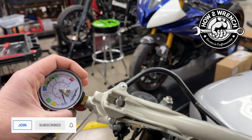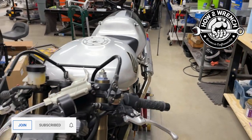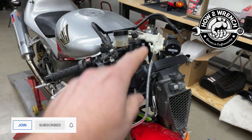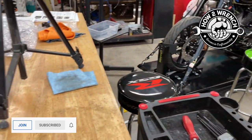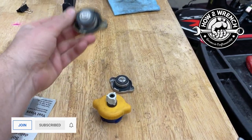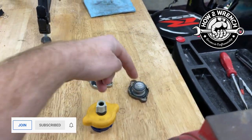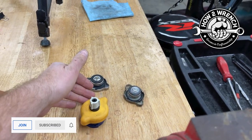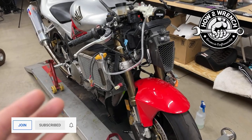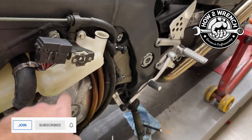These MightyVac tools are at a really awesome price for the do-it-yourselfer. We also have the automotive one, which is more traditional. This thing is awesome because it comes with all the adapters to do the system on the motorcycle, and also comes ready with the adapter to test caps. This one had a bad cap — a bad cap meant it wasn't allowing pressure in the system to let the antifreeze do its job. RC51s are known for overheating, especially in slow traffic, so a bad cap lowered the boiling point of the coolant.